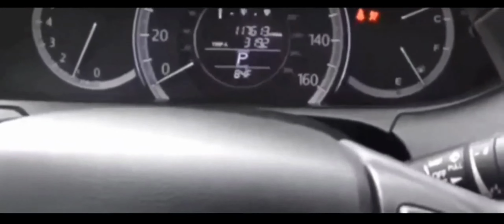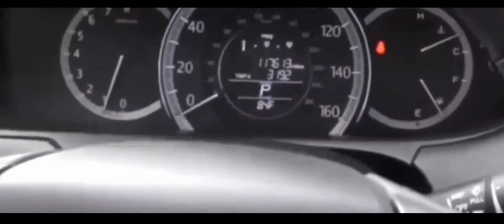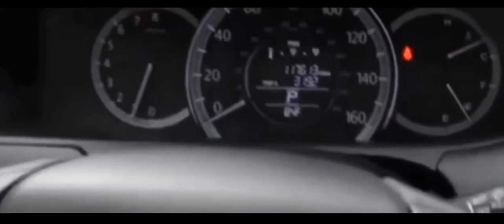Now, in these situations, if you guys have a dead battery, or a remote that for whatever reason has issues sending out a signal to the car that the key is in the car, what you want to do is, even with a dead battery, you could actually start your car by touching one corner of your remote to the push start itself. You guys can definitely do that.